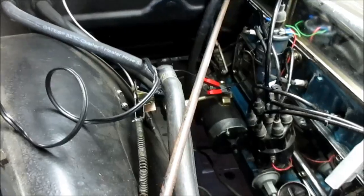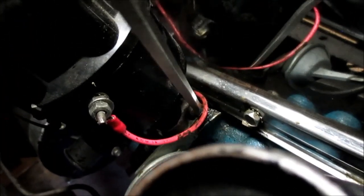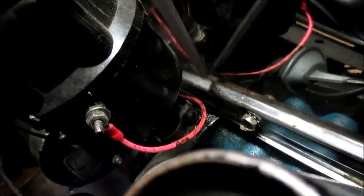We're warmed up. Now the adjustment for the distributor, I'm going to get it. I won't be able to hold it down here while I'm doing it, but right down there is a straight slot screw, right there where my screwdriver is pointing. Try to get down there right that way. Right here. Now I'm going to loosen that, and that's when I'm going to turn the distributor, okay?